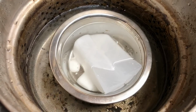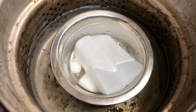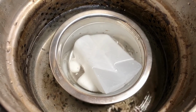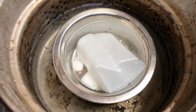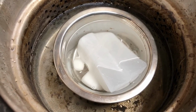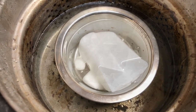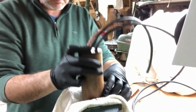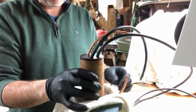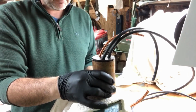Make sure any holes in the coil canister are filled before you pour in the wax, otherwise you'll have a huge mess on the floor. I just use black tape to cover any holes from the inside. That seems to be good enough. One thing I didn't show was that I used black tie straps to create a strain relief on the battery and timer wiring inside the coil canister. That way if the wires get pulled, they won't come out of the canister.